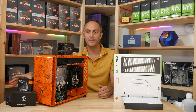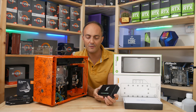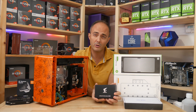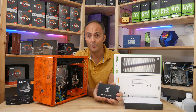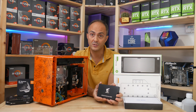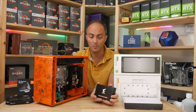That brings me on to a couple of other bits of hardware going in the build — not necessarily water cooling. There is the 2TB Aorus NVMe Gen 4 SSD, M.2 of course. M.2 SSDs are a great idea for Mini-ITX because it just means you save so many cables. Every single storage device, whether it be a 2.5-inch SSD or 3.5-inch hard disk, you save two cables. So if you've got two hard disks and an SSD, that's six cables you can get rid of — no power supply cables, no motherboard cables trailing around the case. Definitely go M.2 if you can with your Mini-ITX build; it'll make it so much easier.